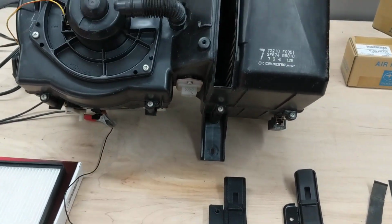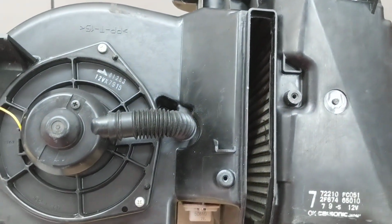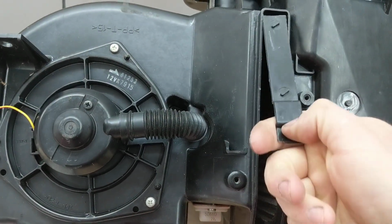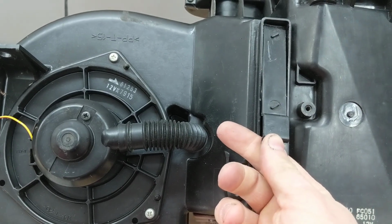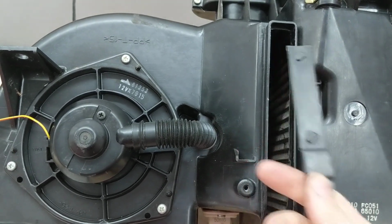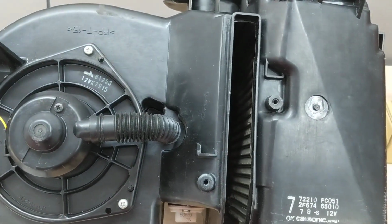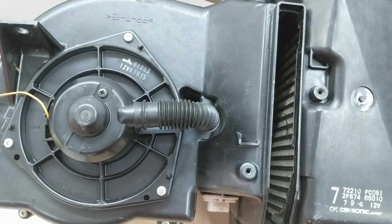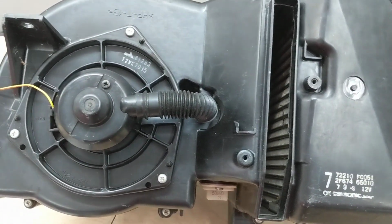The way it would work is underneath the blower box, there'd be an outline of where the cover would go. It would be closed off with this plastic, and you could just cut along the sides with a razor blade and then break it out, and then you'd have an opening for your filter. And if you're installing one of these, I'd recommend that you vacuum this opening out, blow compressed air up there, because there's probably a lot of debris in there.